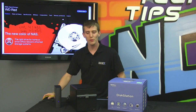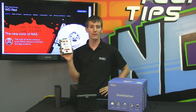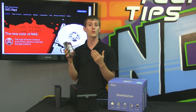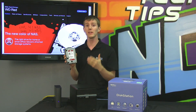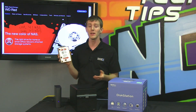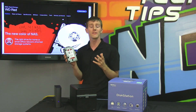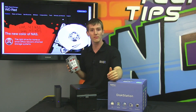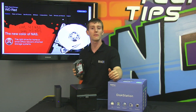So you might as well save a bit of power. The conclusion of this episode is pretty simple: if you're running a NAS environment, pick the RED drive. If you're running a RAID environment as a consumer, pick the RED drive. It's really not that much more expensive than a standard green or blue drive. You get 24/7 tech support, a longer warranty, and enough performance for what you're realistically going to be doing. Even a several-hundred-dollar RAID controller in a large RAID 5 is not capable of writing more than around 70 to 80 megabytes per second, which this drive is fully capable of — it's a fantastic value. If you're in an enterprise environment, get an RE: it is higher performance and has an even longer mean time between failure, but it is very difficult to deny the success WD has created with the RED drive for the everyday consumer.